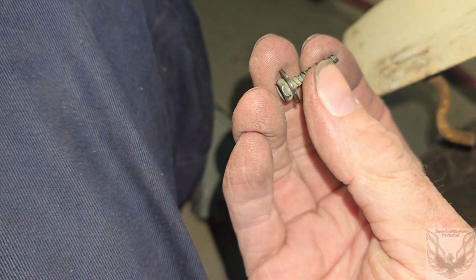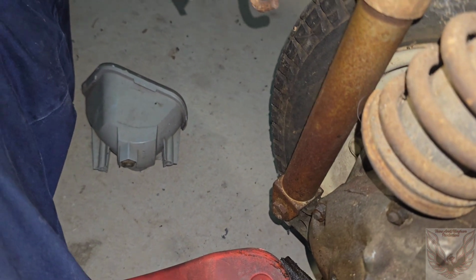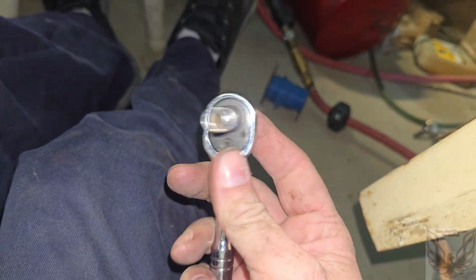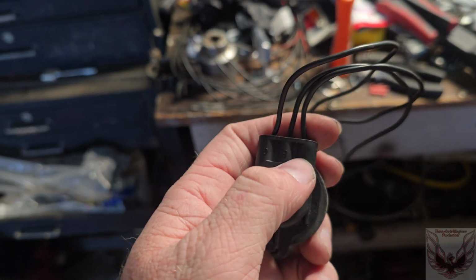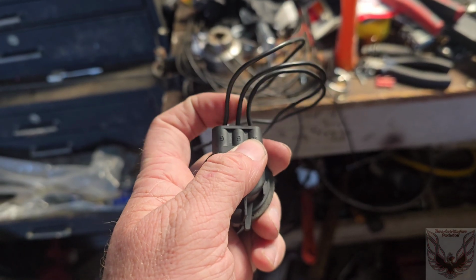And that's all it is, just those type of little bolts, 7 mil. And before you get under there with the long one, come here. Get the short one because the sway bar bracket's in the way. The long one, but all right, let's get this other plug in. Okay, so I'll remember, and well, I'll crawl under the driver's side just to look, make sure.